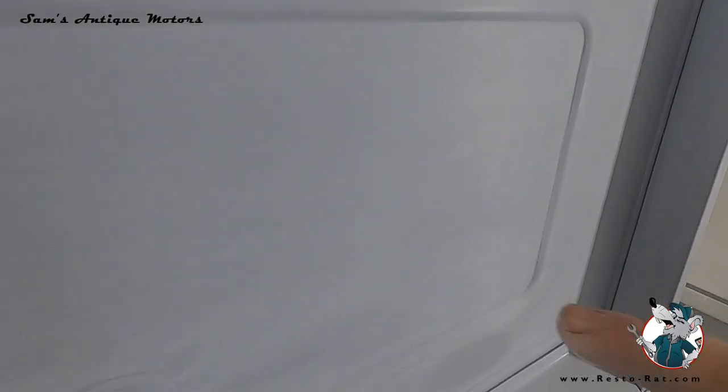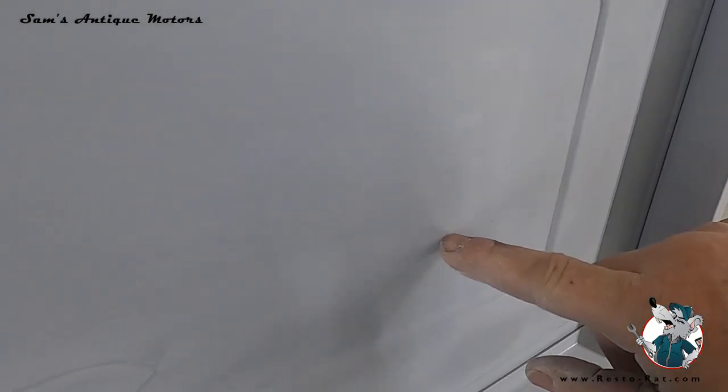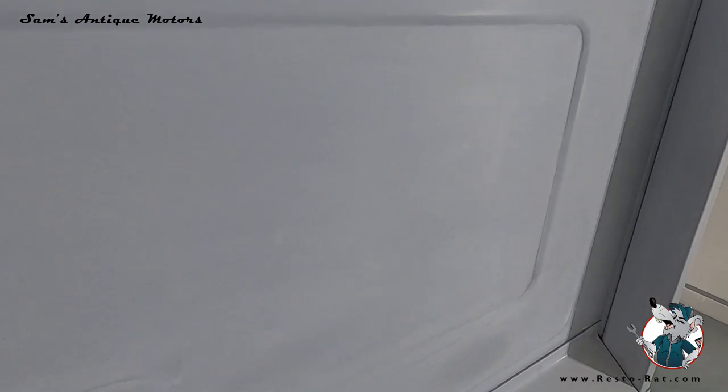I don't know if it's possible to see this, but there are just some little bitty gray shadows right in there, and that's what you've got to get out. If you use a guide coat, it's pretty easy because the black is very evident, but with gray on gray, it's not as easy to see while you're sanding. So that's what I'm trying to get smooth, so it's really, really slick when I put the base coat on it.